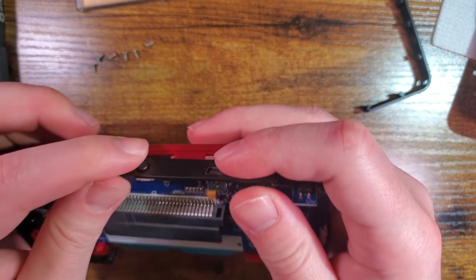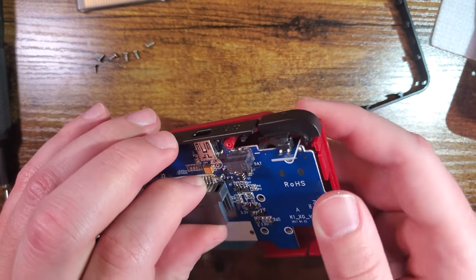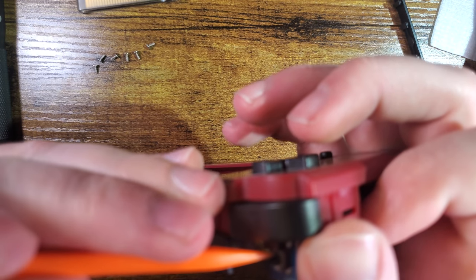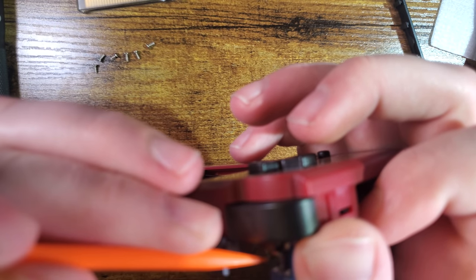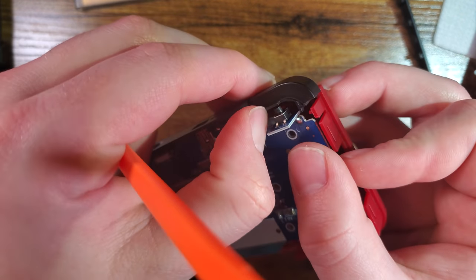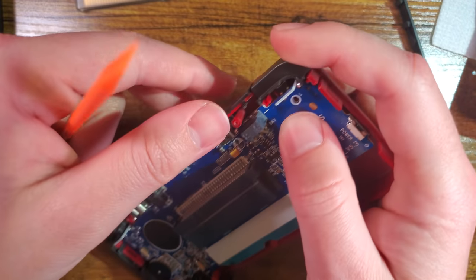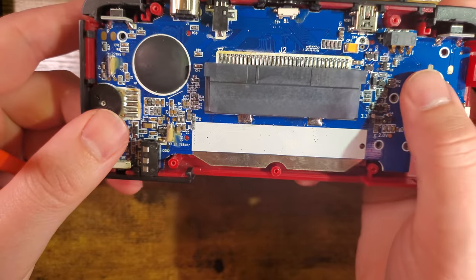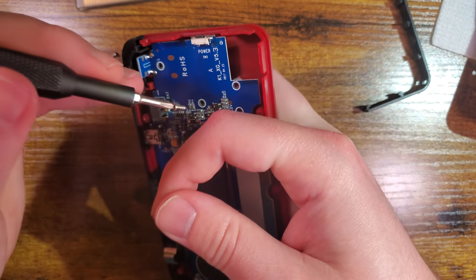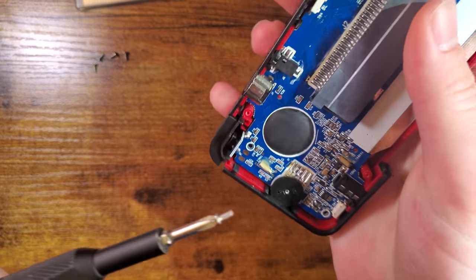As opposed to the carbon contacts, which I believe the specific issue... Oh god, I may have just ruined one of the shoulder buttons. I wasn't paying attention, and the nubbin started coming out. I believe the reason that carbon contacts are used over gold is because the carbon contacts are just cheaper to surface plate than gold is. But gold is likely more resistant to wear over time and or water damage, which a portable might see a lot of.